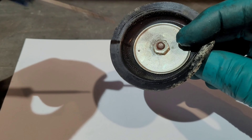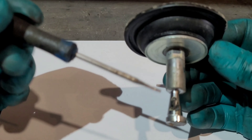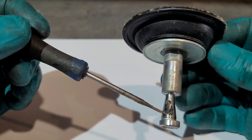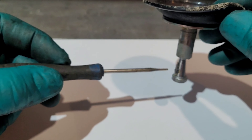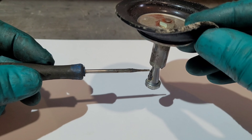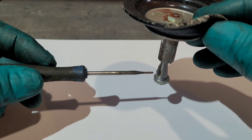There we go — that's our indent at the top which would normally sit at its factory location. That lines up with that marker there, the little black bit. That is where the fuel pin — what we call the fuel pin — rides up and down. So as the pin rides on this eccentric cone, it's relevant to the boost control pressure.